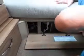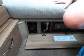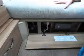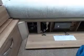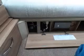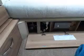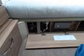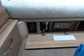If you can see down there, is it your yellow lever? That's to drain your water system. In the position it's in at the moment, the water runs around the system. You lift it up, and that drops the water out onto the ground. If you are draining it, especially for winters, make sure all the taps are open to centre so it allows the water to release out as well. And just fire up your pump for a few seconds to spin the water out of the pump.